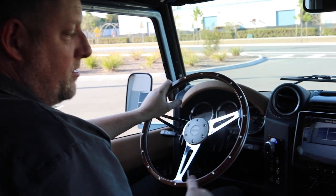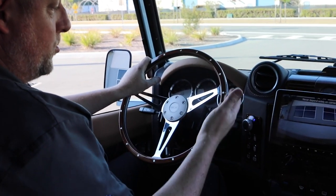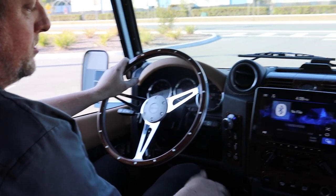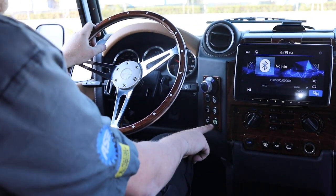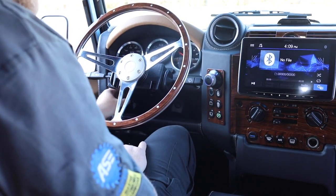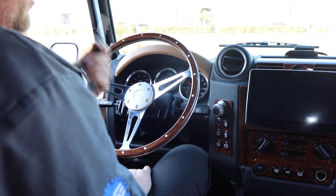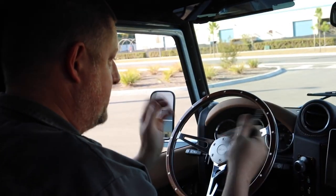We've covered moving. Now let's cover stopping and shutting down. We're back into a parking space. Once the vehicle is still in reverse, we're going to select neutral so it will no longer push. We will engage the parking brake and wait for the indicator light that the parking brake is engaged. Then simply turn off your key. Now the vehicle is locked down, shut off, and ready for sitting.